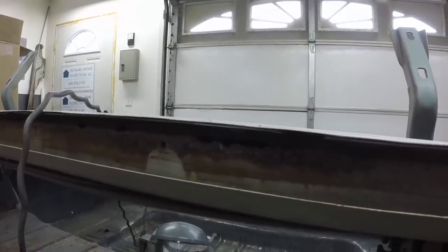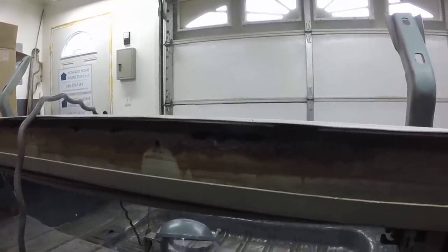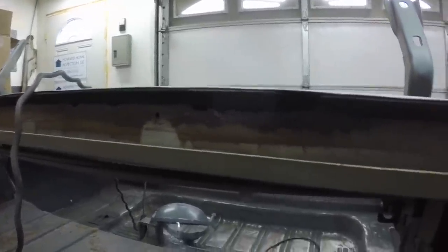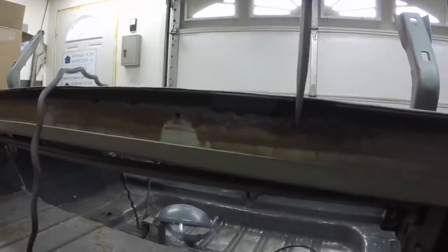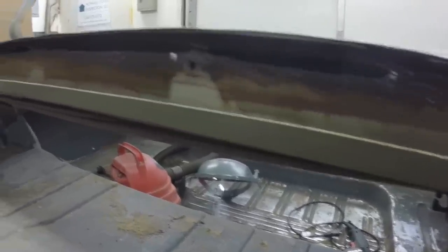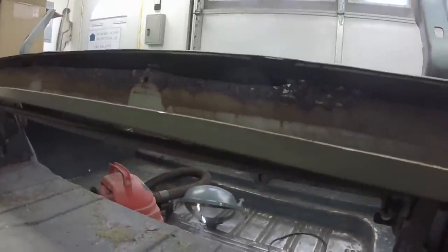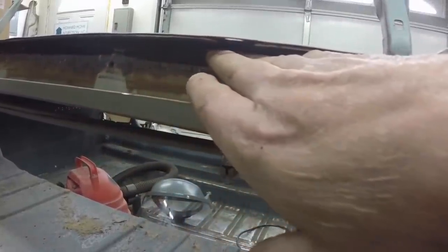It'll probably be about the same amount of work to cut it out and weld it in than it would be to try and clean all that scaly rust off anyway. But when it's weak enough to go through, it needs to be done. I'm going to take my body hammer and work it all over all the way around and see if there's any more. The rest of it, the paint's on it, it looks pretty good. It was mostly from there to there. Then I took my angle grinder and just jammed it in there and really ground out hardcore what was soft. So everything that's bad is out and what's left is fairly solid. I'm going to fit some metal in there and weld it in. I've got to clean this up to weld too, and there's a nice slip up here to weld to that's good and solid.